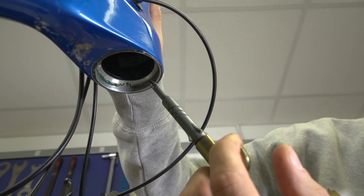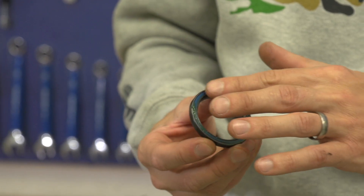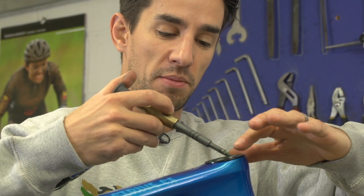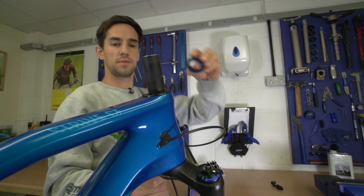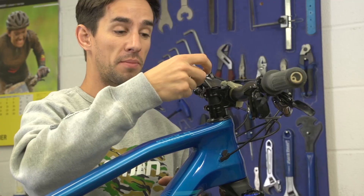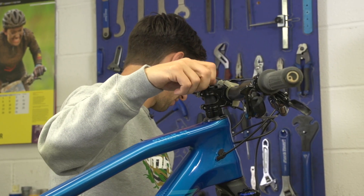I'm just replacing the bearings into the frame — it's an internal headset this one — so I'm just greasing the frame lightly before I slide it in, and then greasing around the top of the bearing just to seal it nicely and make sure my steering and bike feel really nice and smooth. I'd also put a fair amount of grease onto the bolt of your top cap because water can come up the steerer tube and it can get rusted in there, so make sure those are clean and greased up.